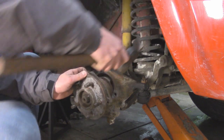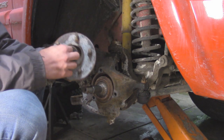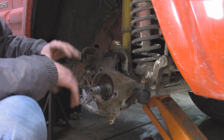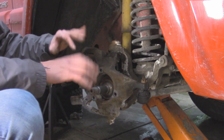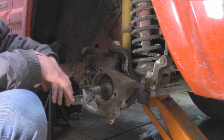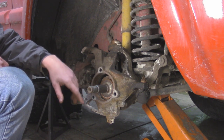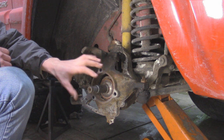It's almost out — there we go. Be very careful to leave your axle shaft with it as it pulls off. Don't forget your washer — sometimes it gets stuck in there. Push that axle shaft back in. You're going to have a brake dust shield that goes between the unit bearing and the knuckle. This Jeep has rust issues so those are long gone, but make sure when putting it back together that you orientate it correctly — otherwise the rotor could contact the dust shield and make lots of noise. Before putting the new unit bearing on, I want to clean up the surface where it mates onto the knuckle. Take a file or wire brush, get any rust and grime out, and I'm going to put a thin coat of anti-seize on there to help with future maintenance.